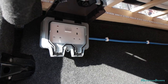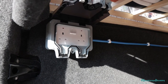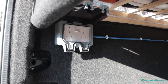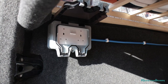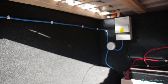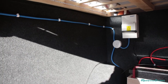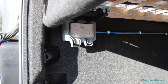While we're out here, we've also wired up an outdoor 240-volt socket that we're going to be able to use for 240-volt appliances. We put a waterproof one in here just by the back doors — it's relatively close to the back door, so if the back doors are open and it starts to rain or you splash water onto it, it's protected. All it's done is wired back into our 240-volt system in the back. We've put a small splitter box just underneath the distribution box, which goes out into the cab but also brings a feed back here. It's going to be a really handy addition to run any small 240-volt appliances.